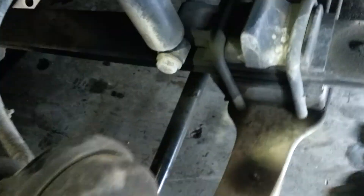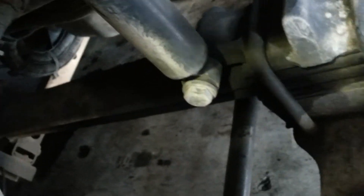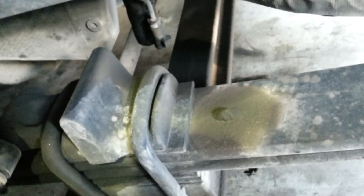You'll check your brake chamber hoses — make sure they're not cracked, leaking, frayed, or loose. Your brake chamber should be secured, not cracked, with the proper nuts and bolts. Check your U-bolts. Your shock absorbers should not be leaking and should be secured with the proper nuts and bolts. Your U-bolts should not be cracked. Your spring leaves should be secured, not cracked, none shifted, none missing. Check your axle — make sure it's not cracked.